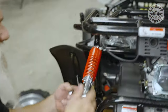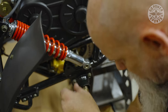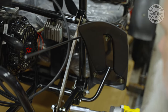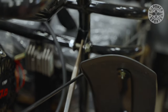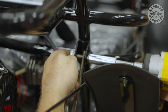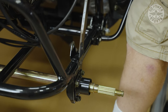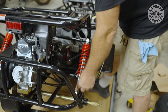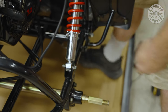Your back suspension shocks are disconnected. We're going to pull the bolt so we can get ready to attach this in, and set it aside for now. On the other side, this is where the support bracket is built on, so you'll have to take both the top and bottom bolts out. When you take this off, it's going to want to fold up on you, so put something underneath or hold it in position. The spring goes on the top side, and the bottom is the base — once you get this on, pick it up, slide the bottom bolt in, and start assembling your shocks.